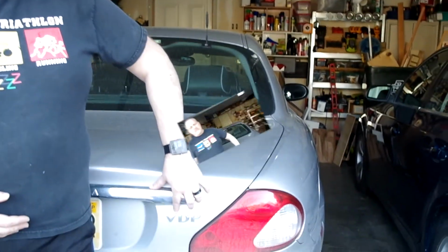Thank you for watching today's episode, even though we failed to actually do the repair. But I think one of the big wins was that every other video that I've seen on YouTube has the location incorrect. Now, I don't know if it is because mine is the VDP and it is automatic, and a lot of people have manuals, but in the automatic VDP 2004, the fill and drain plug actually are not on the side of the differential, but they are in the back of the differential. And so I think that by itself is a win.